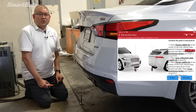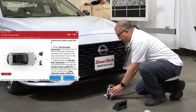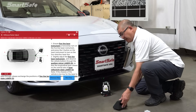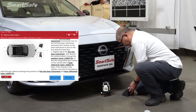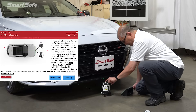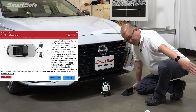Now we'll move back to the front of the vehicle and turn the laser on. We'll go ahead and place our five-line laser and point it back to the reflector using our auxiliary mirror. We should be able to see that reflector. We click the V button one more time, and this gives us our center line.